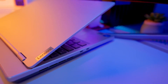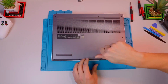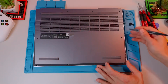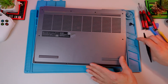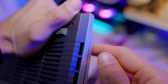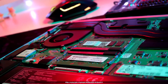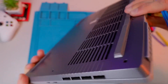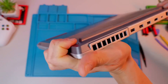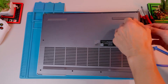Let's start disassembling the device by removing the 10 screws with a Phillips screwdriver. The four front screws are noticeably shorter. The entire cover is also held in place by clips, and to release it we usually pry it open with a thin piece of plastic. Prying with a screwdriver or metal tool can damage the plastic, break clips, pull out a wire, damage a circuit board trace, or cause a short circuit. That's why a plastic spudger is highly recommended, although here I couldn't find a suitable spot, so I used a suction cup instead, which allowed me to neatly separate the two parts.